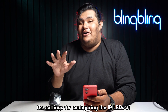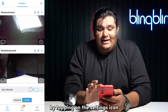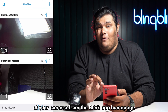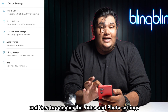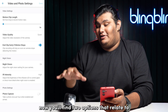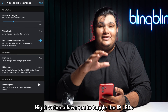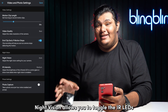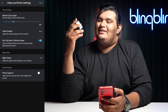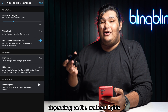The settings for configuring the IR LEDs of your Blink camera can be accessed using the Blink app by tapping on the settings icon besides the thumbnail of your camera from the Blink app home page, and then tapping on the video and photo settings. You'll find two options that relate to the IR settings of your Blink camera: night vision and IR intensity. Night vision allows you to toggle the IR LEDs — toggling it on will turn on the LEDs, toggling it off will turn it off, and setting it to auto will allow the camera to toggle it on and off depending on the ambient light.